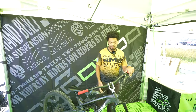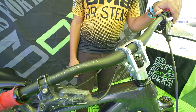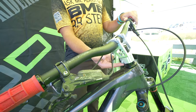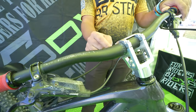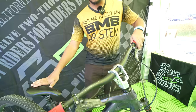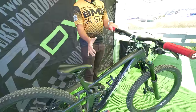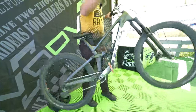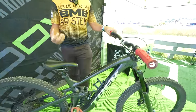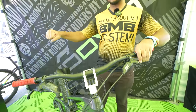I'm Bronson Moore with BMORE Bikes. This is the RR Raced Reverse Mountain Bike Stem — this is the new prototype 90-millimeter tall version. It's 90 millimeters from the bottom of the base to the centerline of the bar, and keeps the same minus 15-millimeter reversed offset. One of the things you get with the raised position is more leverage over the bike, so you have a lot more leverage for maneuvering. You also get a more comfortable position with a better angle of your arms to the bars and more bend in your arms for better control, before getting to the arms-lock no-control type situation.